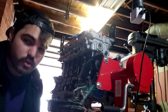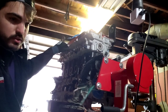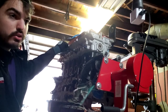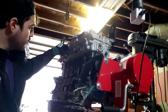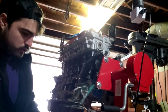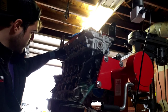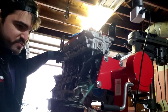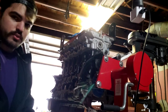Oh, I got a transmission on order. It's a Liberty LSC 5-speed. I ordered that like a month and a half ago. And that'll be here in April, so expect a video in April or a little bit later in April, depending on when it gets here. And it's an LSC 5100 5-speed manual. H pattern, it's a dog box with symmetrical dog engagement,